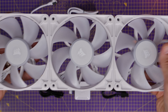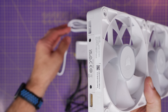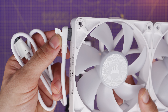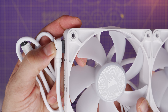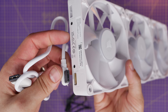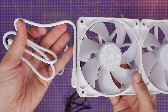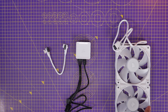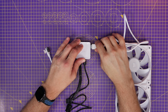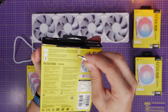That's the straightforward way to connect the fans in their daisy chain logic. The cables can go from fan to fan, but they can also go from fan to controller. Watch out that you don't try to plug the cable into the wrong port — the one without a connector. The actual cable port is at the bottom part of the fan. You need to pay attention to this when installing fans in the case, making sure cables face the right direction to reach the controller.